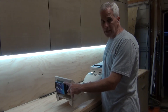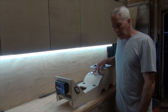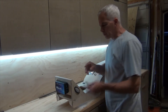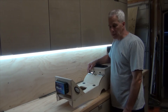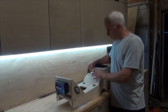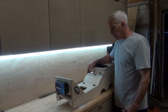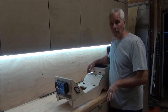This is the Ron Francis I-Start system — it's a keyless ignition. There's a touch button right here. When it's all plugged in it works great. When there's no key fob around, this button just pulses red to indicate it's in security mode and can't be started. When you approach with the key fob it goes solid red — ready to start. Touch it once for accessories, again to start, or hold your finger on it. Touch it three times to shut off; clutch and brake have to be in.